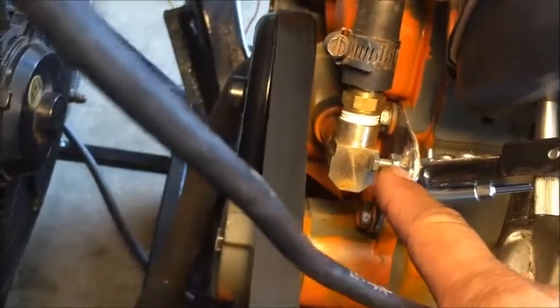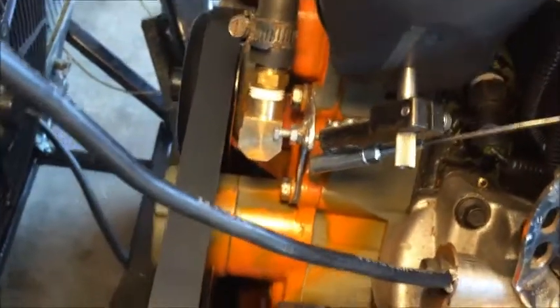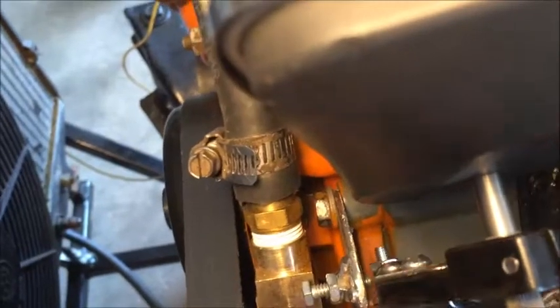That's just to show you it was going down towards 20, where I have it set. Without this stop screw in there, you're not going to be able to get that idle control motor close to its home position at idle — it's just not going to work. You have to have a way of cracking the throttle open a little bit. In my other video I showed myself removing a gear in here, just so that second spring isn't holding the throttle open even more.